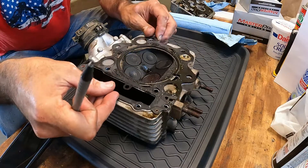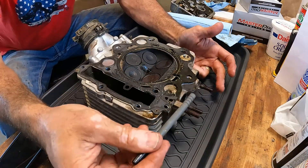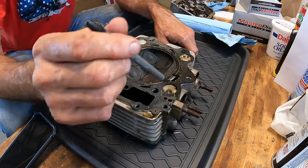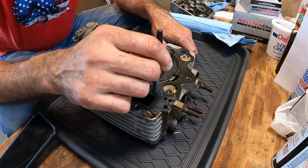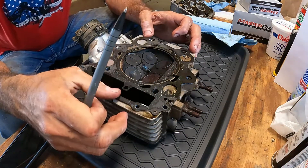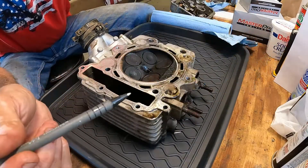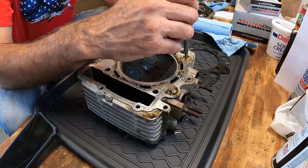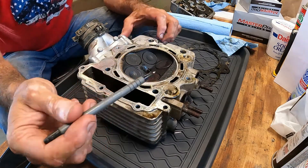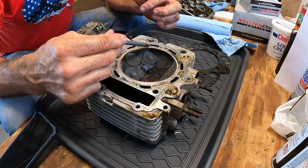I think this bolt as well was not getting all the torque. So we've got a head gasket failure. You can't really see much on the other side, but we definitely burned through that right there. This is a locating dowel. These are coolant passages going around the cylinder head, but you can see carbon getting in and around these cooling passages back here. Conversely, up here it's gasket material — it's not that black, brown, sooty stuff. This is just gasket leavings and that kind of thing — nothing's leaking out up here.